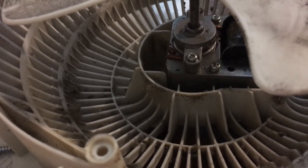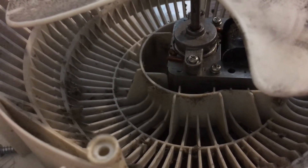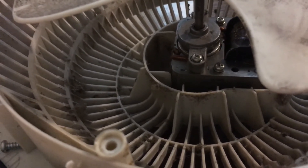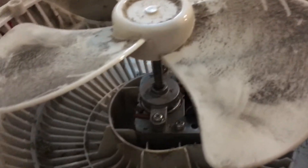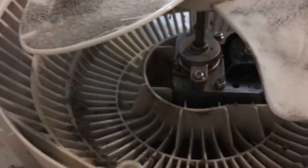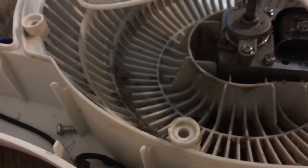There's a video — I can't remember the exact name, but it's called 'Window Fan with Weird Symptoms,' a Marvin window fan video. He pretty much explains how it happens. This was doing it because the common wire — the black — had no power going to it, which is why it would just barely run.